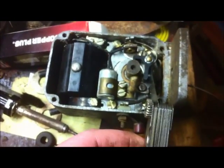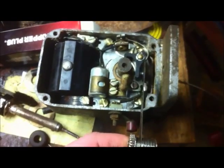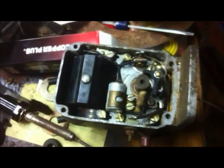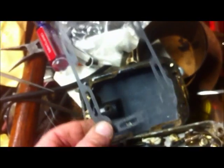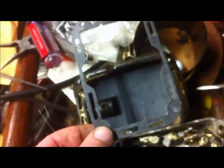I've got the points cleaned up — they actually came out really nice. I've got them gapped to 15 thousandths with my feeler gauge. Now I'm going to put the cover back on and see if we have some spark. This old gasket was shot and it looked kind of wet inside the magneto, so I'm going to put a nice new end cap gasket on first. Now we've got new gapped points — and check this out — plenty of blue spark.